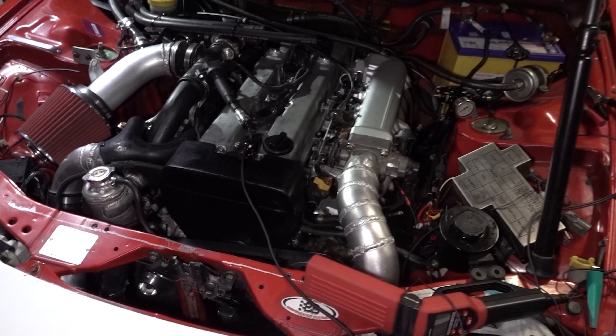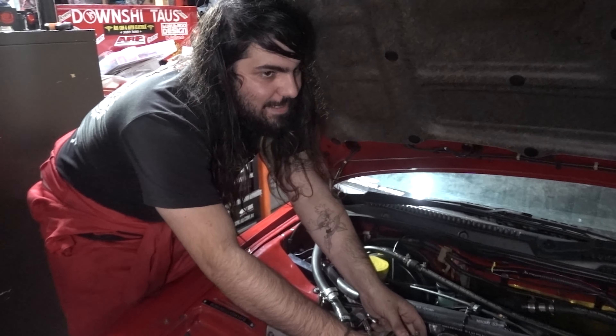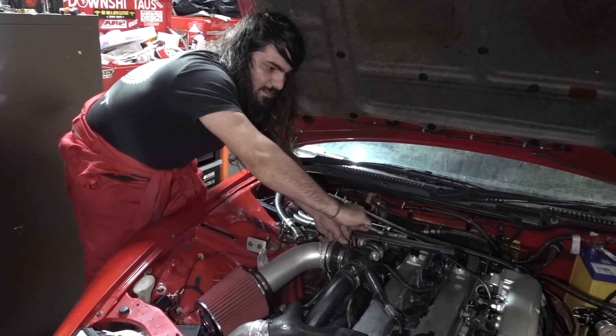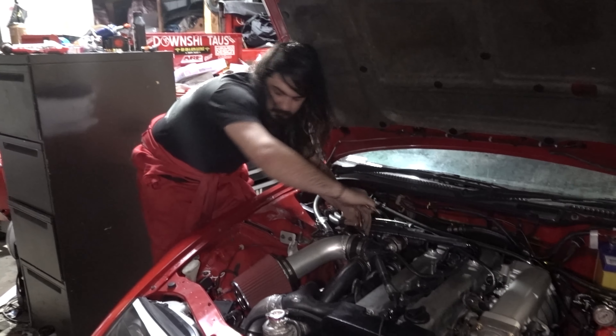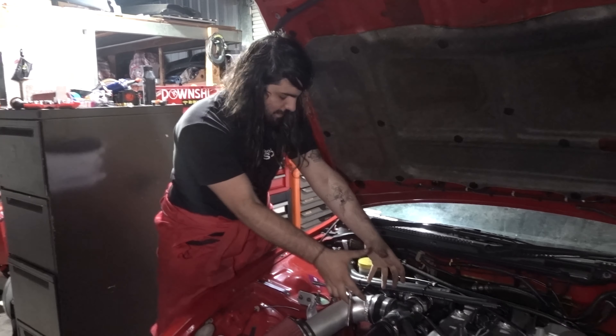This is why I like Toyota motors — I just don't like their chassis that much. A 2JZ in there would be pretty dope but I'd rather put a 2JZ in a Laurel before I'd put one in the 300ZX. I think it was back in 2017 I saw a 2JZ-swapped one going up Nebo — very tidy, but the turbos sit a bit higher and further out compared to J ones. I'm keen to see the height and sizing of a 1JZ twin turbo in the R32's engine bay once my hot side comes back.